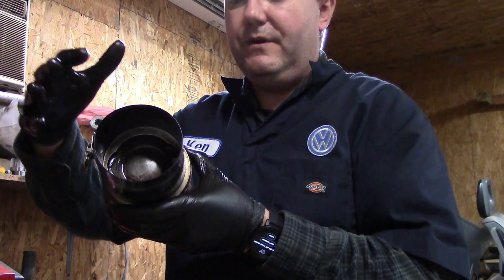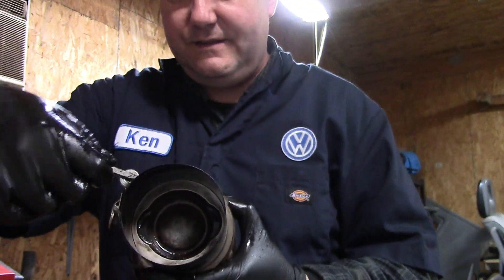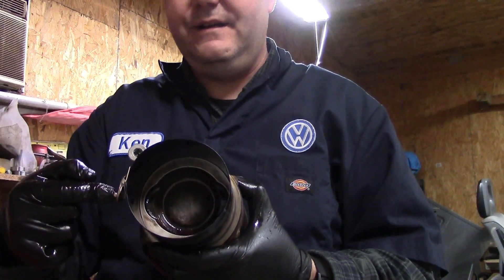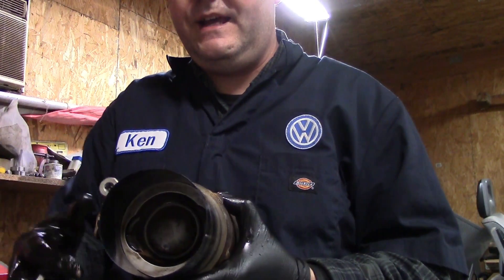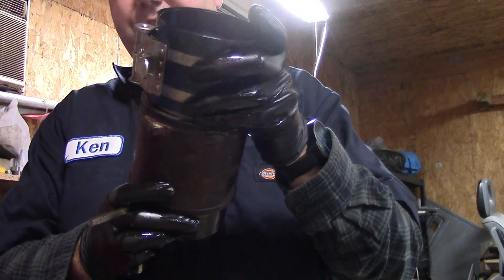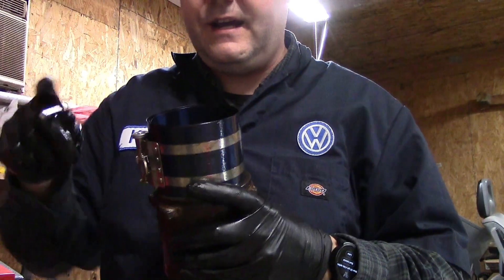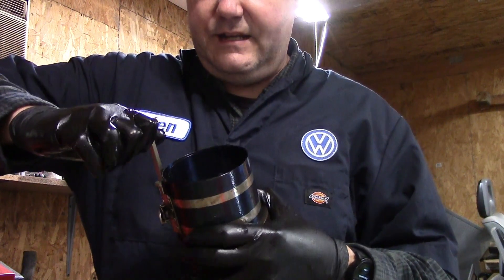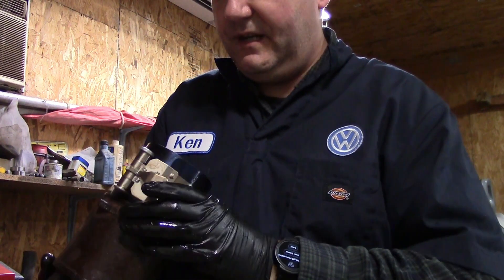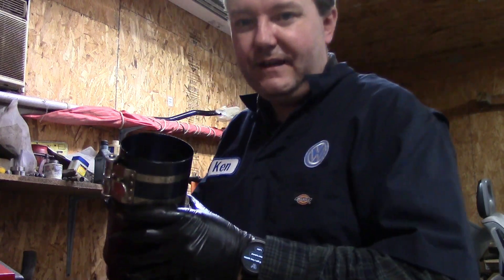When you're tightening this up, you have a special driver tool that you use to tighten this. Even when loosening it, you push this little button — but keep the driver tool in, because if you push this button without it, the whole thing expands and it's a big hassle to get it back to normal size. So start putting the piston into the cylinder in the orientation you want, put this tool on top, and tighten it down as tight as it will go. You want it fully compressed.